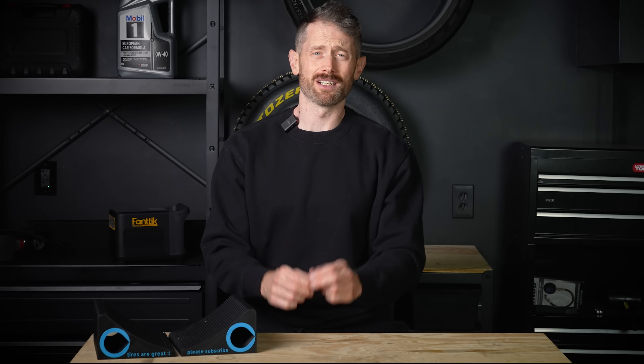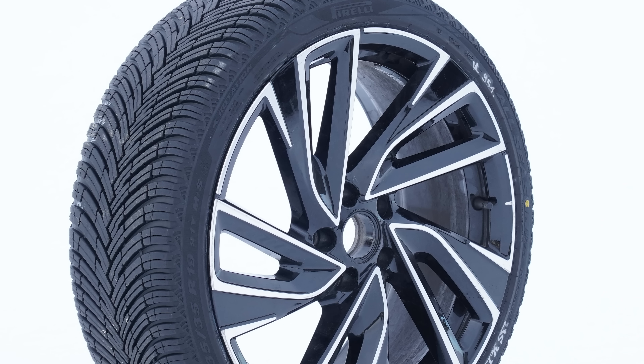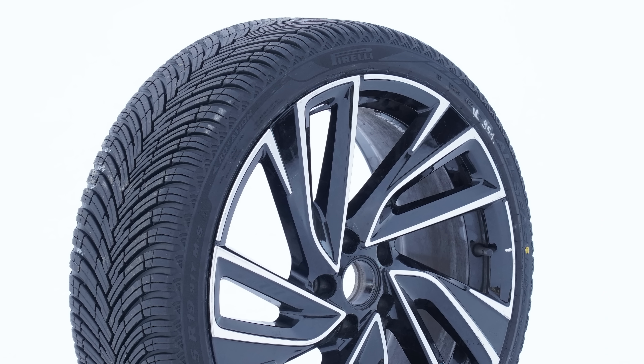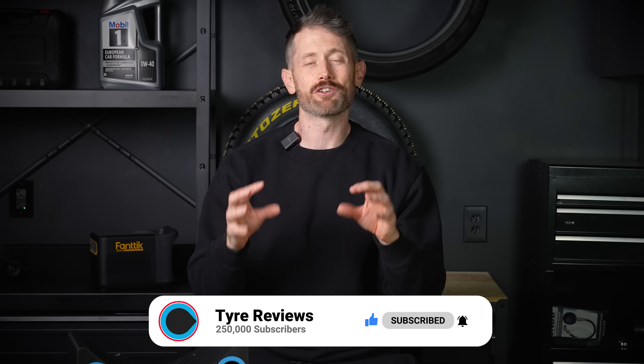So there you have it. Is it a good idea to mount your directional tyre backwards? No — I'm sure none of you are surprised. You do actually get a little bit more snow braking, but you're giving up grip almost everywhere else. It's not actually a huge amount of grip, apart from in deeper water, but it's fair to say you should not cross-rotate directional tyres — they are directional for a reason. A huge thank you to Pirelli for supporting this crazy idea; not a lot of tyre companies would. The new Pirelli Cinturato All-Season SF3 won my most recent all-season tyre test, it's won Auto Express, and it's doing very well in all the tests across Europe — it is one of the class-leading tyres, so consider it if you're thinking about buying an all-season tyre. There's going to be loads more interesting tests on the Tyre Reviews YouTube channel in the coming weeks, so be sure to subscribe. There is a Patreon or membership if you want to support crazy testing. Any questions, please ask below, and as always, safe motoring.